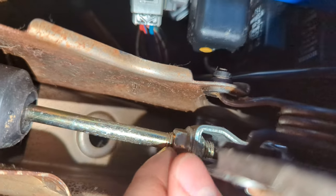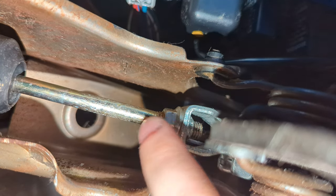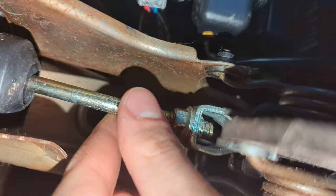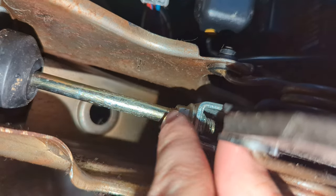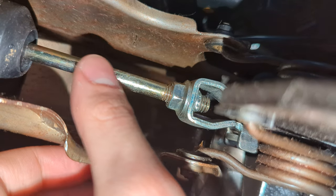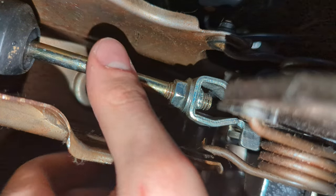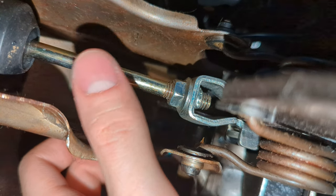This is just the push rod. The other nut was a 17mm and this one's a 12mm. You just loosen this and then grab onto this — you can see I scratched it up a bit. I used needle nose pliers; mine's a bit beat up. You could probably use vice grips or pliers with a cloth. It's not the easiest thing to spin, but it's also not the hardest. You just loosen this and you can back it off or forward.